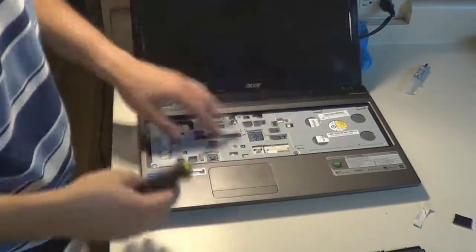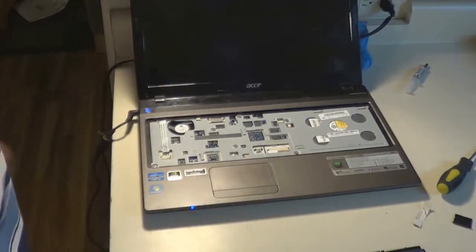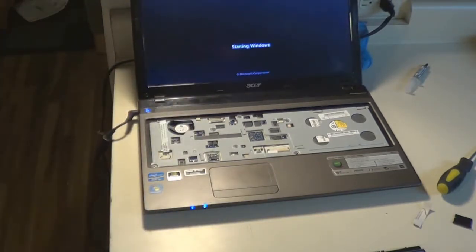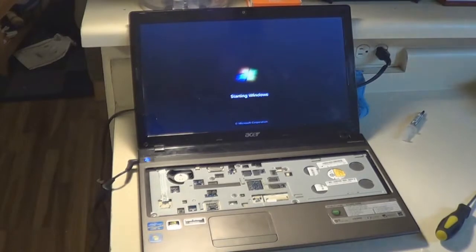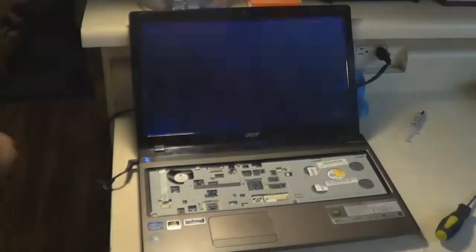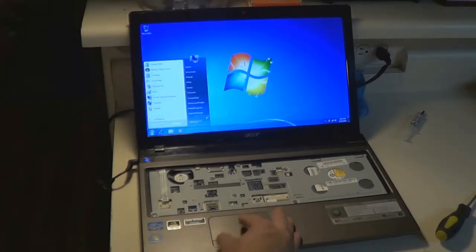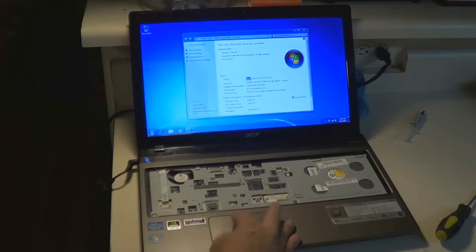And you want to make sure that when you're taking your laptop apart in the first place, all the screws are organized in a manner where you don't confuse any of them. It's real easy to have two screws that look almost exactly the same, but one has slightly smaller diameter and threads, and you'll only discover this when you put the laptop back together and put it in the wrong hole. And it's a huge hassle to get those kinds of screws out, or you might ruin the threads of the screw hole if you screw the wrong screw in, etc.